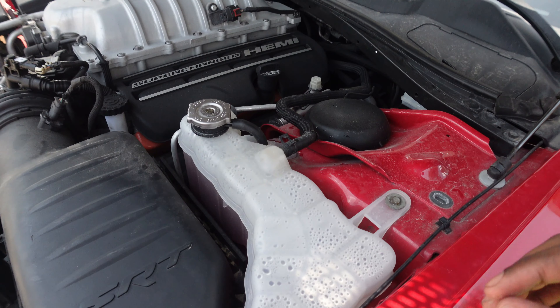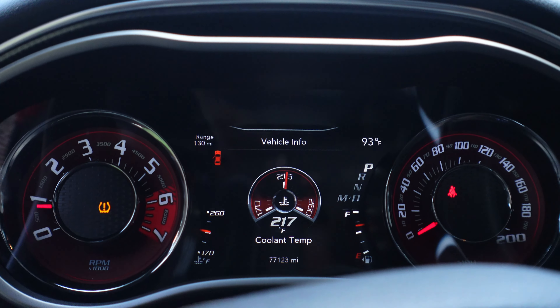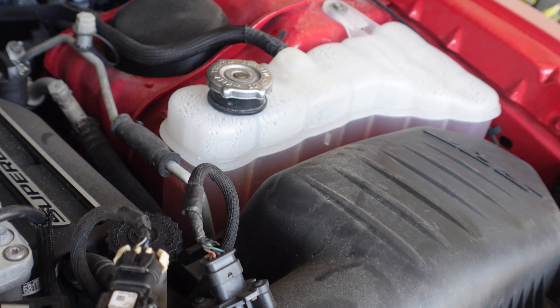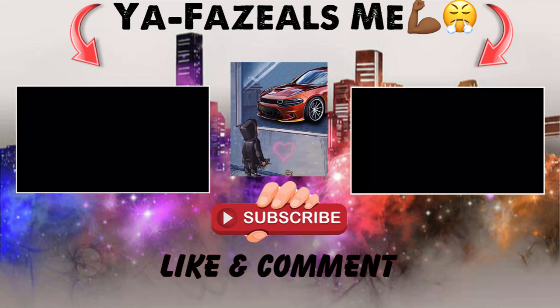Normally when it gets this hot it'll leak to this little tube. My camera is literally about to die, but when it drops down again I want to test if my flames work — yeah, they work, I heard it. I gotta do a coolant drain because I know it's that water-coolant mix. The hose wasn't getting coolant to it so I probably need to take it off and recheck. The temperature is still high — there's air built up in there, and that's the only reason.